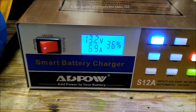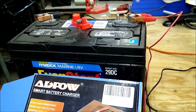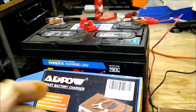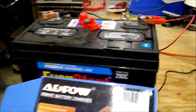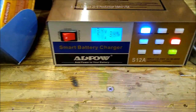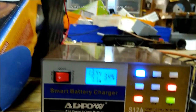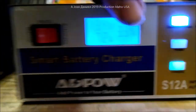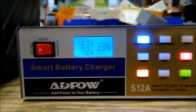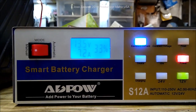So if you thought it was a good battery because it read 12.6 or 12.8 volts — that's typical of a Walmart battery. You test them and you're like, hell, it's a good battery. Well, not always. I want to make sure the battery is really in premium condition before we put it in the RV. Right now it's at 34 percent and it's in charge cycle, pushing 13.5 volts at 7.2 amps.